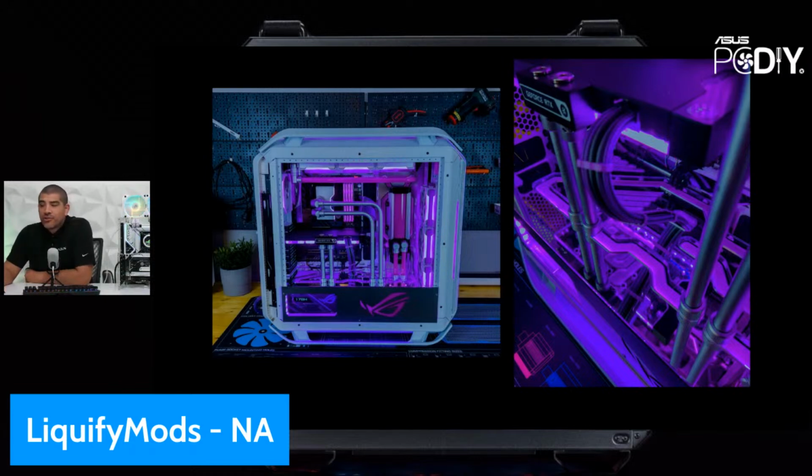Now that's an interesting choice. Generally, AMD has a reduced port table, so when you go into either 4 DIMMs that are single rank, or 4 DIMMs which are dual rank, you're going to reduce the memory controller's scaling support in terms of how fast the memory can run. But I'm assuming the requirement to go with 128 might be because the user specifically needs a high density configuration.